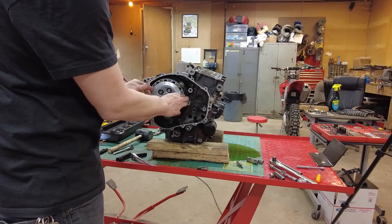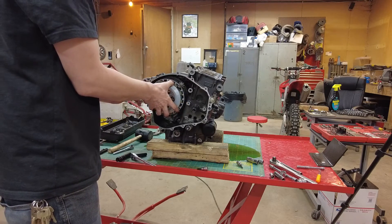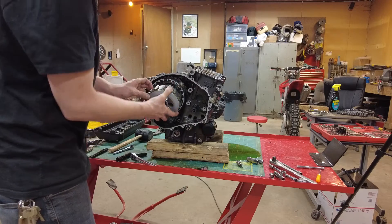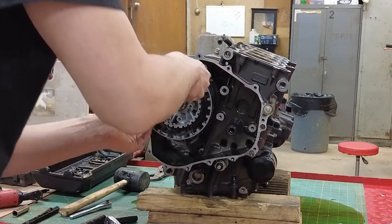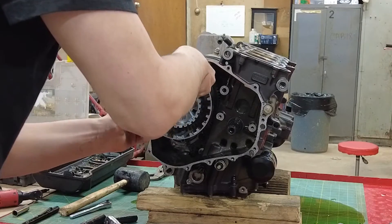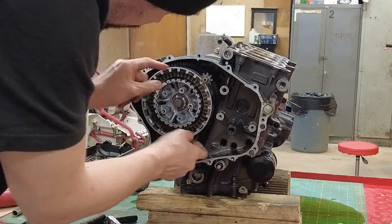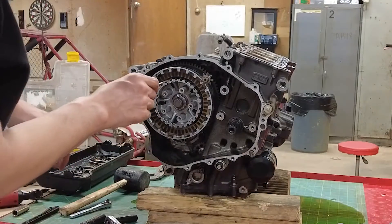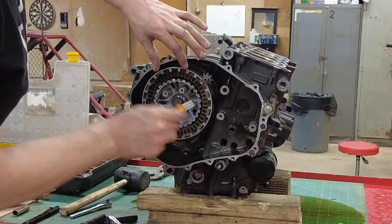Now if you're watching this video, I assume it's because your clutch was slipping and you're trying to fix that. You're just going to change your fiber plates and possibly your steels. Personally, I like to change steels as well. What you're going to look for in here right now is burn marks or hot spots on your pressure plate and clutch center. If you've got hot spots there, you're going to need to replace those two. Likewise, if you see any hot spots on your steel plates, you're going to need to replace them also.